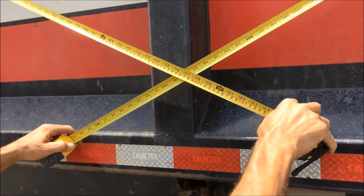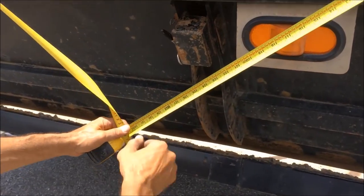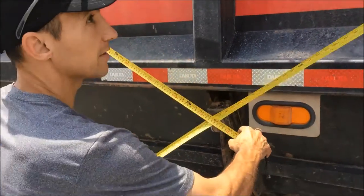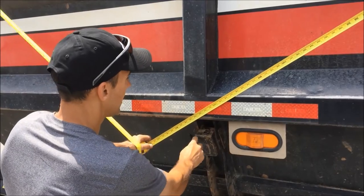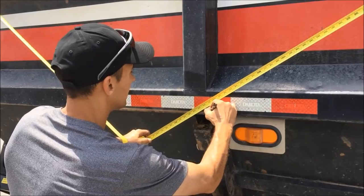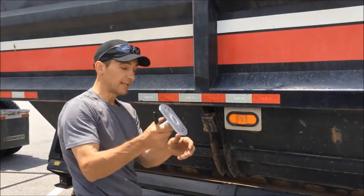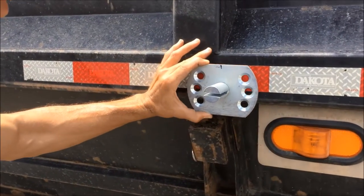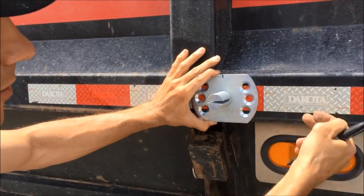If I were to come up 6 inches or so it would be 117, and if I came down here it would be 125. What I'm showing there is it creates a nice plumb line down through regardless of where you are. So if your side rail is higher it might be a different number. So at 121 inches I'm going to drop one tape measure, take my marker, mark my center location for the pivot point, drop my tape measure away, bring my pivot point into place, and put the center of the pivot point on the center of my marker, keeping with the center theme — center on the side rail.